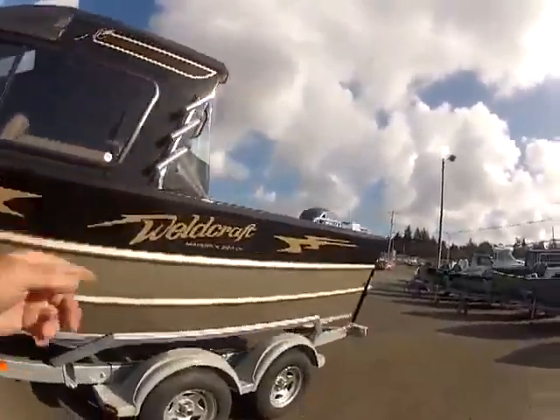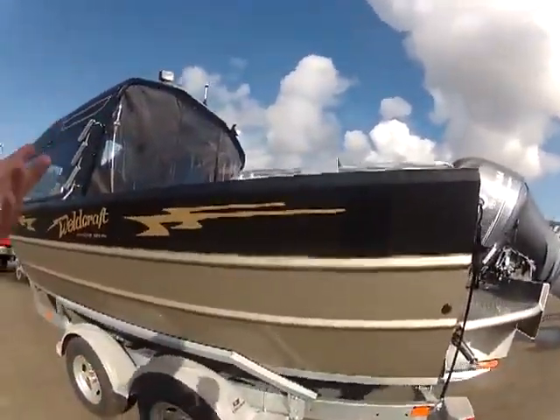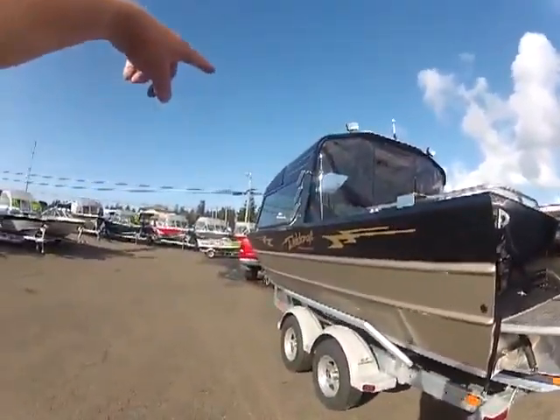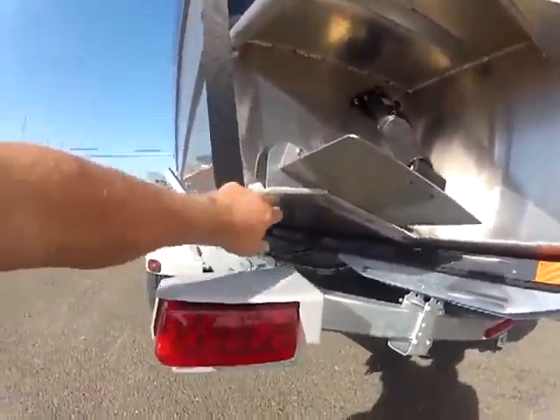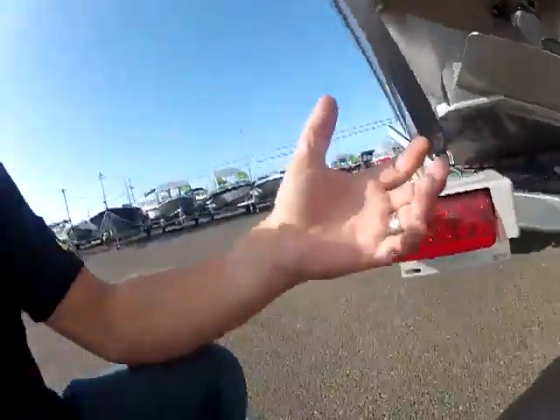This is the Deep V — 39 inches tall, which is nice. The degree of the hull in the back, you've got 18 by 28 midship, which gives you a nice ride. Plus these reverse chines right here — big bonus. This is the reverse plus the reverse flat pad. It's like a big base coffee cup: the bigger the base, the harder to tip.